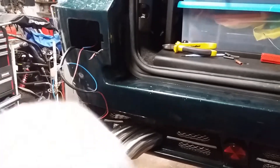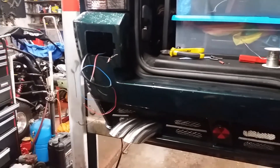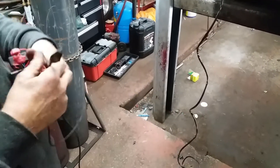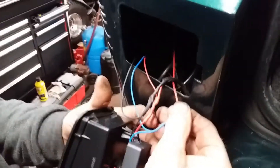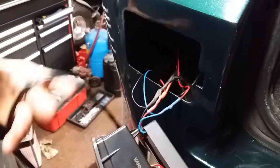Just need to check one thing on the new lights — they have a red and blue wire, so we need to know which wire is for the side light and which is for the fog light. This is where you're going to need a voltmeter, that'll come in handy. Wires are all connected with heat shrink on them all. Blue is the side light, red is the main fog, and black is the earth.